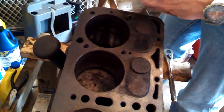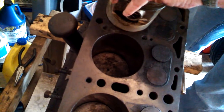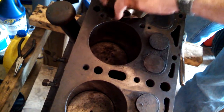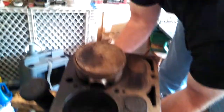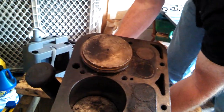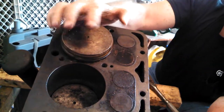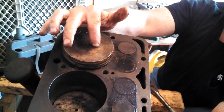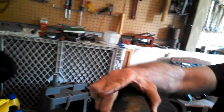You can't make the piston the exact same size as the bore. Even here it's a pretty tight fit but not exactly tight. You've got to have that little bit of clearance because when this gets hot it expands — and if it's exactly the right fit it'll plug the hole and won't move, it'll just break.